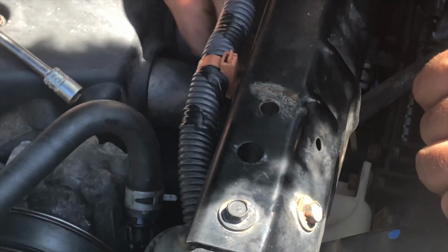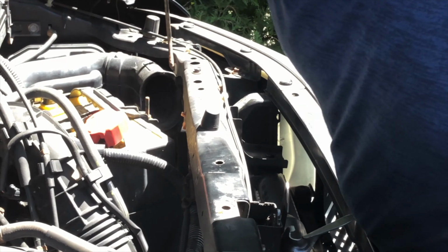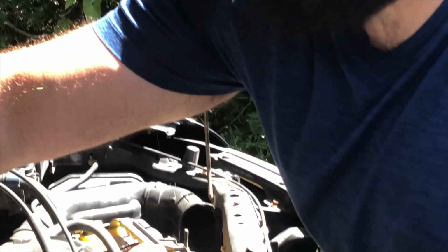So that means literally you guys could use this video. All you have to do to replace the radiator is, I wonder if you could pull this with the fans out in one assembly, right? All you have to do is just disconnect a little radiator hose or whatever else is there. So that really makes it pretty easy to do a radiator in case you ever need it. Feel free to use this video to refer to it.